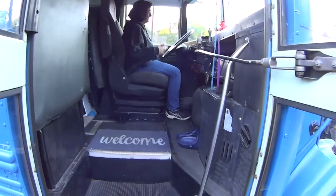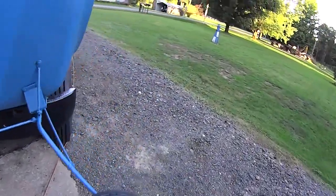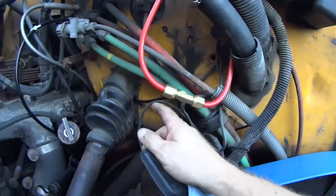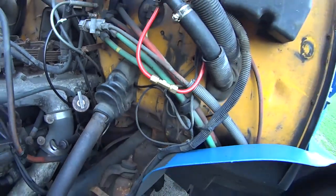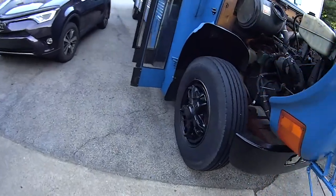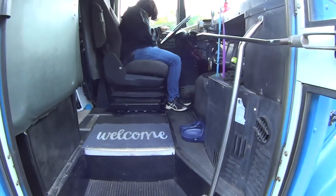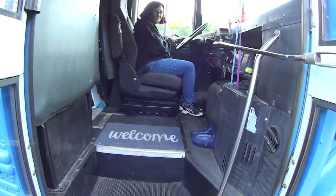We've got the airline all hooked up. All you've got to do is find a line that's got air to it of the right size. Here's the line I was talking about — it originally went up to here, but I just cut it, put this T in, then cut a boot in the steering column and ran the line right through there. On the inside, I've got it zip-tied so it doesn't interfere with the steering shaft, but allows movement so that when the seat goes up and down it's fine. I'm going to lower it and raise it up and show the audience — the audience of four or five people that watch. I appreciate the consistent watchers, I really do.